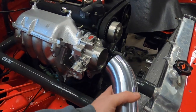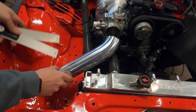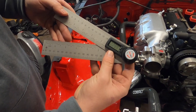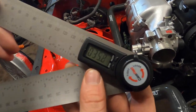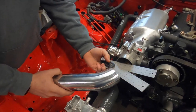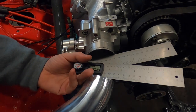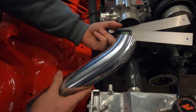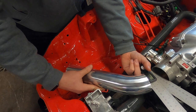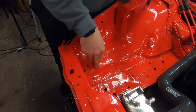First thing we're going to do — I've already got this cut — but 45 degrees here is too much for the radiator. So I'm going to take the 45 and combine it with another 45. This cool tool, as you open it, reads the angle that you need to cut. 18.5 degrees worked perfectly. So I'm going to cut 18.5 degrees off another piece of pipe; that'll give me a straight and then 18.5, putting the pipe right where I want it in the fender well — or the headlight pocket. Then I'm going to drill a hole with a 3-inch hole saw right through that and feed it underneath the car.